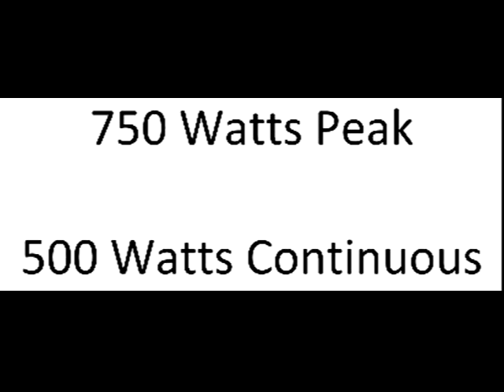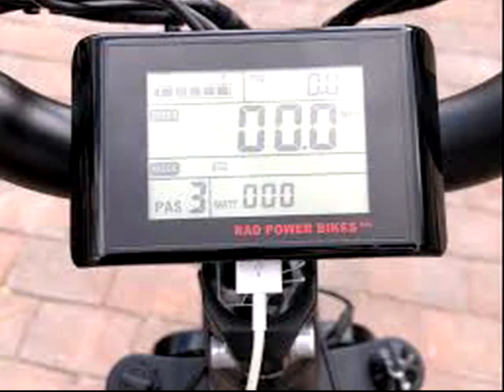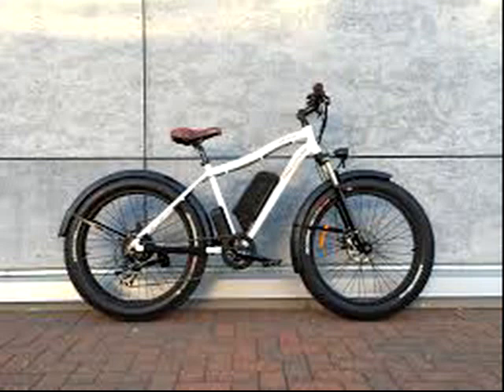I completely agree with that, and it was suggested: don't go slowly up mountains. That turns out to be very important because at slow speeds motors become very inefficient and spend more power on heating than on horsepower. It was suggested that if I'm riding up hills I should use pedal assist PAS 3, which is about a 300 watt limit, or PAS 4, which is about a 500 watt limit. As an engineer I would expect the bike to be protected from life-limiting operation — we call it idiot-proofing. I believed the motor was good for 750 watts and that overcurrent and over-temp limits should protect the motor.